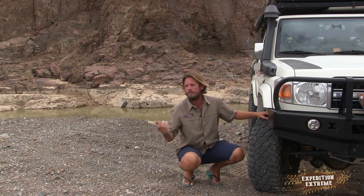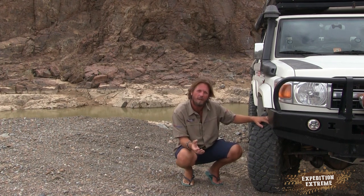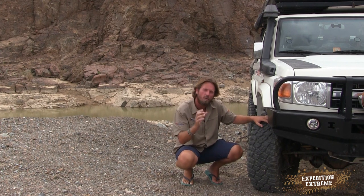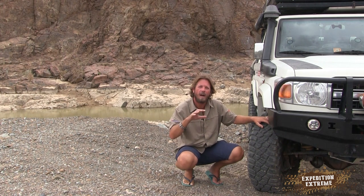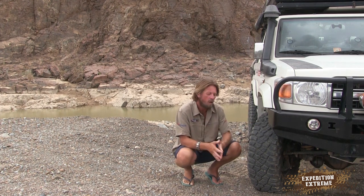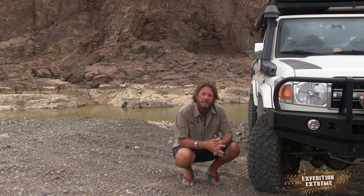First thing you would normally do is probably go to the lowest setting. No, I don't want that wallowy feeling. We're not going to be doing that much rock crawling. So you've got to find that fine tuning as to where the shock is going to give you the correct rebound and the correct ride. We're going to go from rocks to corrugation to rutted track, and I want all-round performance. This is where this Toughdog suspension really comes into its own. It doesn't take you 3 or 4 minutes in the vehicle and you know you're on the wrong setting.